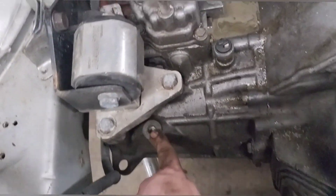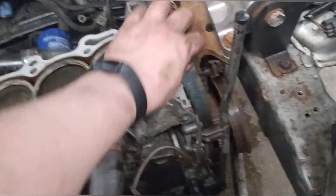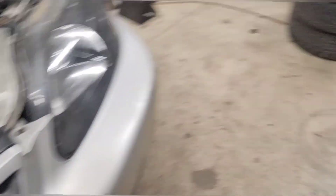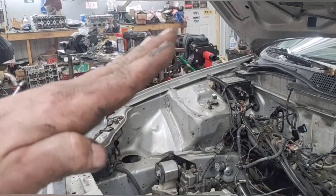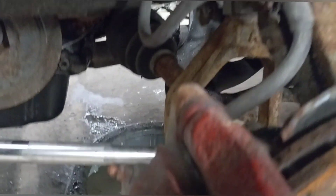In the comments I told them you have to modify stuff to make them work — mainly the rear T-bracket. This mount, as long as you have a JDM transmission, these three bolt holes are here. If you have an American transmission the bolt holes are in a different position, and that hole is not tapped so you have to tap it. Mine is a JDM transmission so it works. You also need an F22 or H23 mount on the post-mount side for it to work properly.